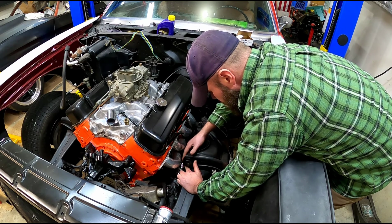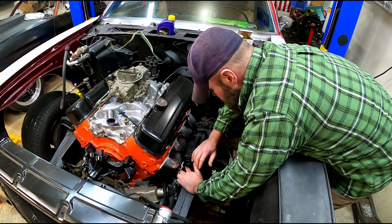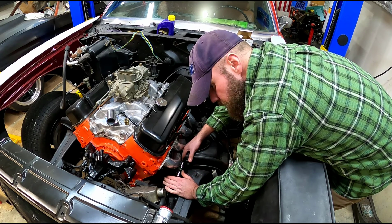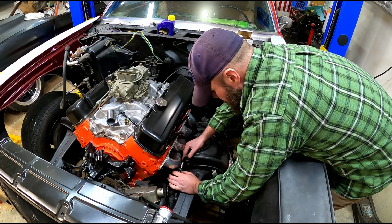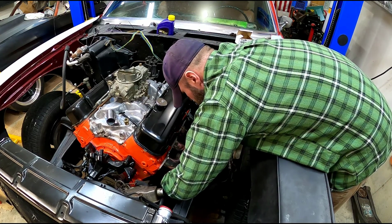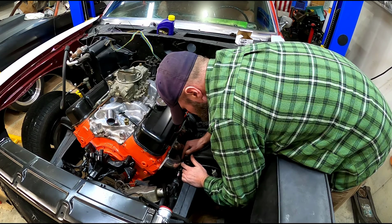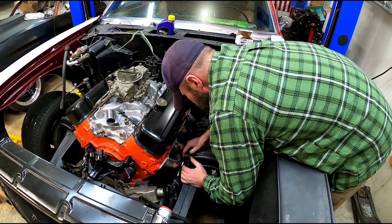And it's going to rotate, obviously, right? And this is a fixed point. Other than the vibration the engine's going through, this is a fixed point, so you got to watch out for all these. So where you position it on the steering box is going to be important. You don't want to have any bind in your steering, or be scratching your headers or anything else. So plan carefully where you put it. Make sure you check it through the rotation of the steering box to make sure that you're not going to have any interference with the header or with the frame here or this upper arm.